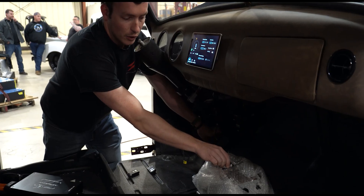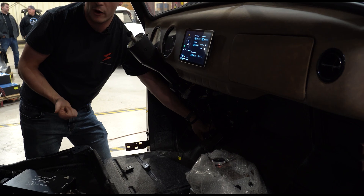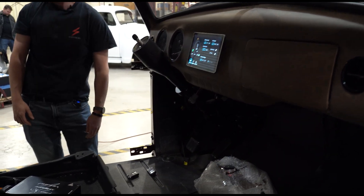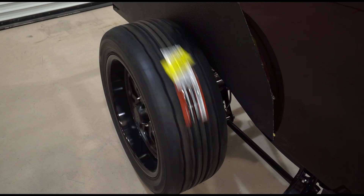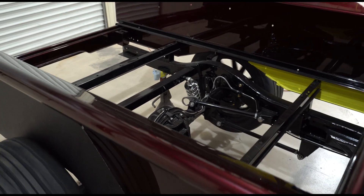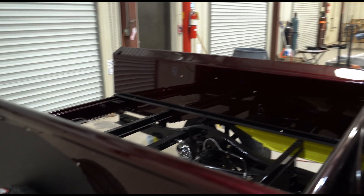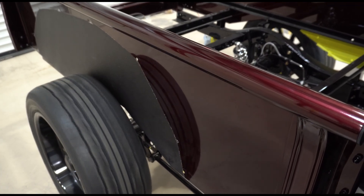Press the brake. We're going to turn the rotary into neutral and then into drive. You can hear the Wilwood parking brake disengage — that's an important feature. We made sure that it will release so that we can spin the wheels. Now when I let off the brake, the wheels should slowly spin forwards, which you can see they are. We're just free spinning — we're not going to spin them up super fast right now, but we just want to make sure that they are spinning in the correct direction. On some vehicles it might have a little bit of drag and you have to give a very small throttle input to get it to spin. We're going to check the reverse direction — stop the wheels, put the shifter into reverse — and that looks correct as well. Everything is spinning in the backwards direction.